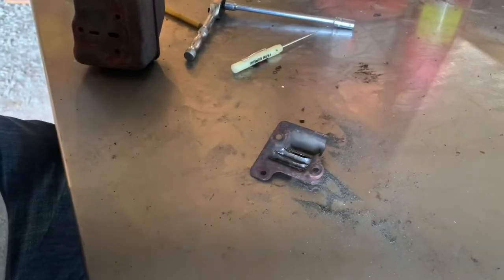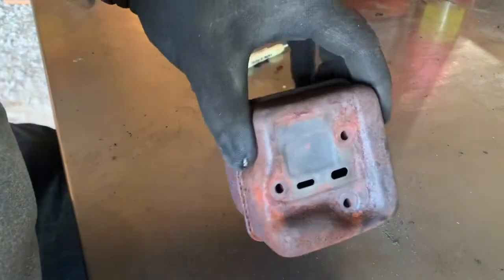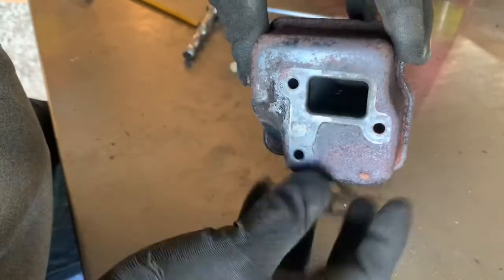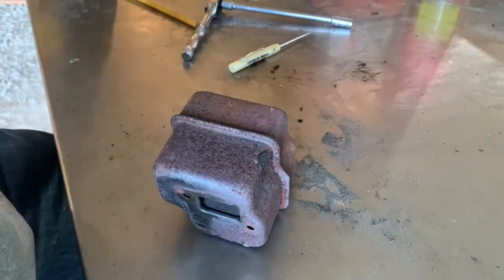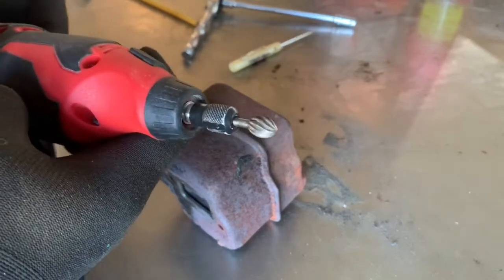Next I'm going to set that to the side and bring my muffler in — it's nice and rusty. I'm going to drill roughly two 3/8 holes right here and then get to the baffle on the inside and clean another shot through there. To do that, I've switched out the head on my die grinder, lowered my speed, and I'm going to use this.